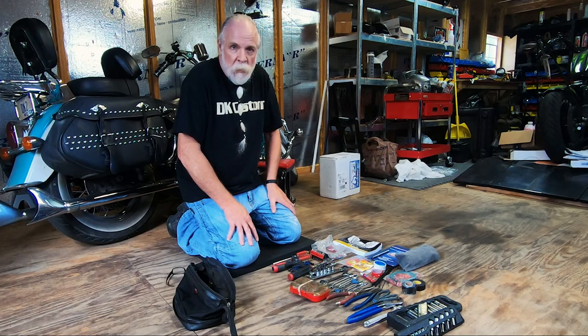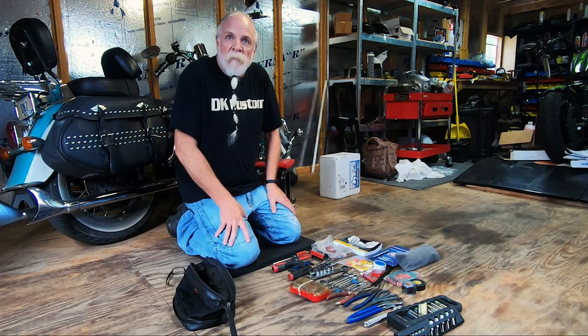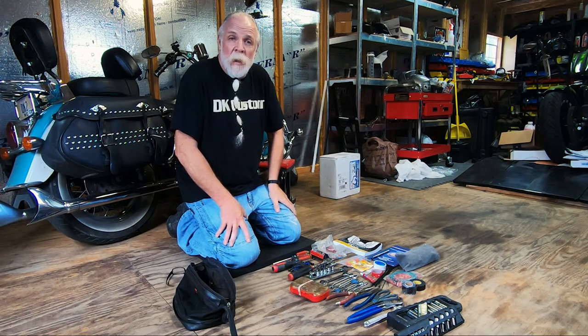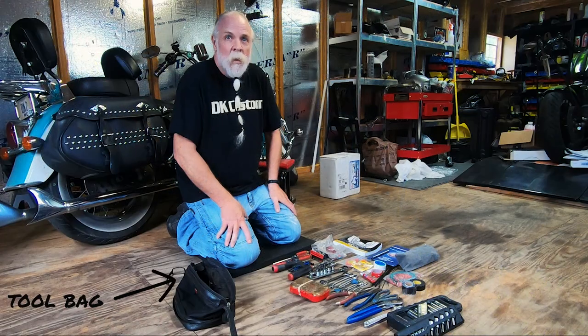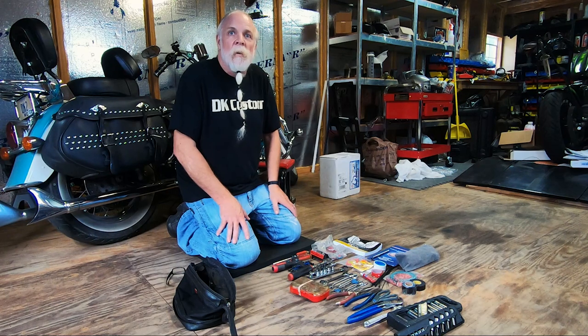An example would be, and Dwayne, you can put a picture up. When we were traveling through Canada up to the Arctic Circle in Alaska, we left a motel one morning and it was snowing and our electric gear was working only intermittently. I had to, on the side of the road, figure out how to make that electric gear work 100% of the time because it was cold. So I had to pull it apart, find where the broken wire was, and repair it so that we had our electric gear working.